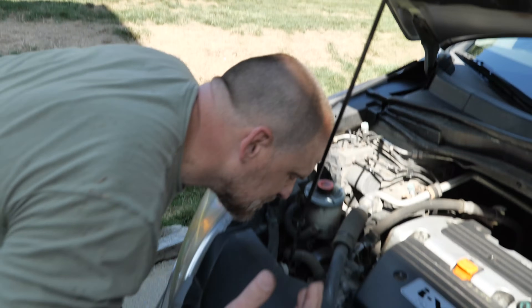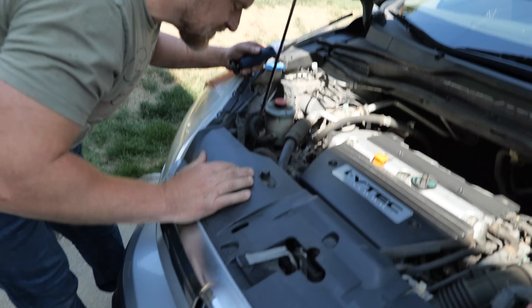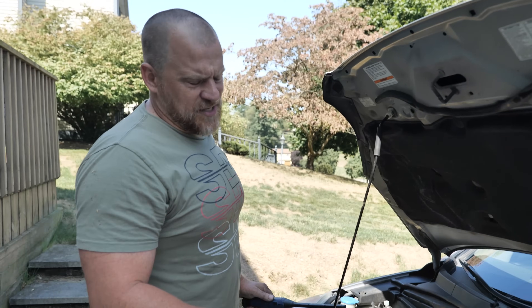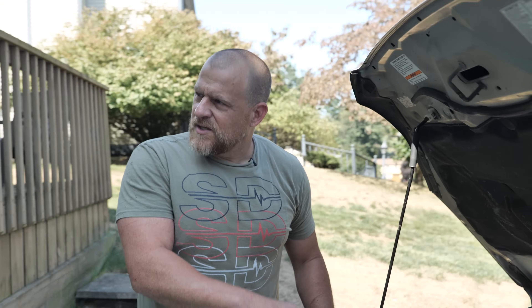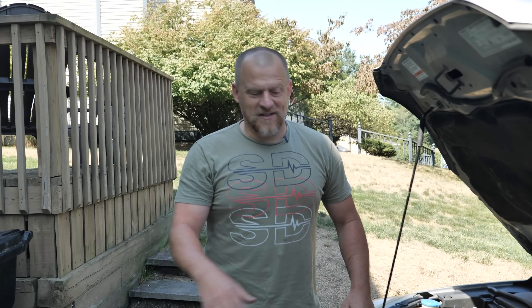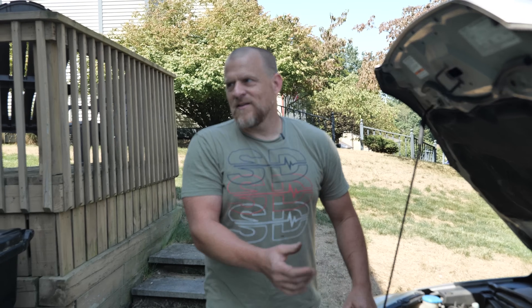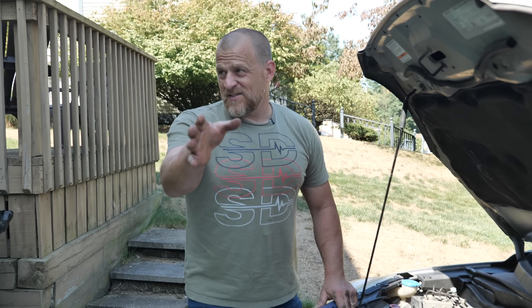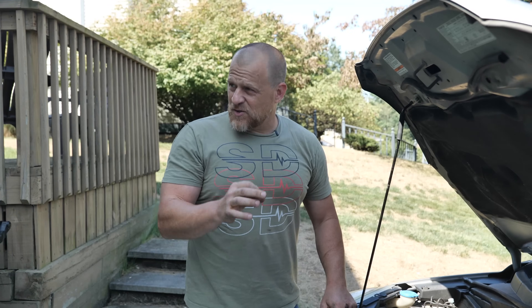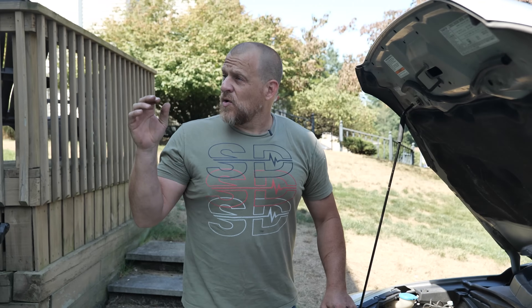Okay, kill it. The good news is this is some type of a bearing noise, not an engine noise — that's huge. This isn't going to be 'you need an engine.' Water pump bearing, I'm not sure yet. The camera isn't picking this up but I smell something electrically burnt, so he saw smoke and I smell electrical burning.